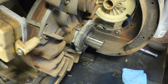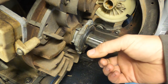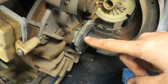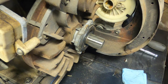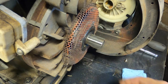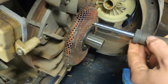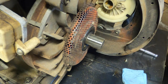If you're having the problem where you're pulling and pulling and it just won't catch, or you pulled on it and then it ran and it made it so it wouldn't catch, or you have to hit the front of it, or it makes a really loud squeal and potentially ejects the handle — doing this service will save you. It is important to put the dust screen on because that dust screen actually holds the rubber or metal cap in place. Without it, the likelihood of that coming off and exploding is pretty high.